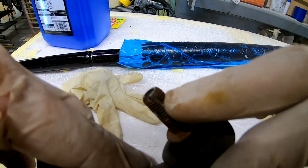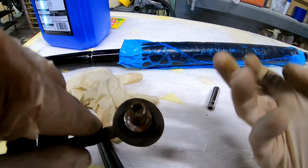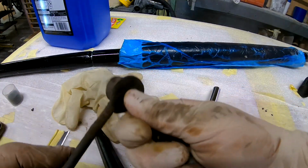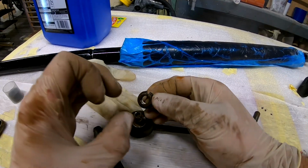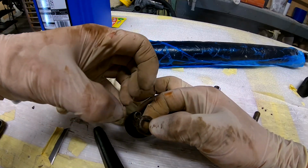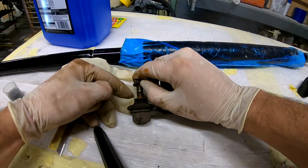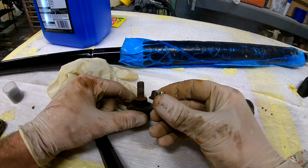It did not come off because these threads right here are gone, disappeared, and they were stuck. So once you round this fully off, right here, that's it. You cannot put anything there. So this spins inside. So if the nut is stuck, you need to cut it to make a relief pressure so the nut expands. Because once you hit it, the nut will start to open up slowly, and it will start to open. Then you will be able to spin the nut freely. And you see a thread, it's easier to cut this off as long as you have space with the angle grinder or anything. But the safest bet was this.